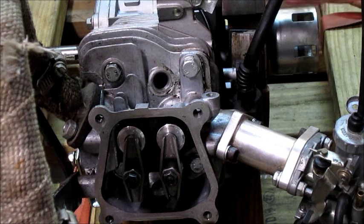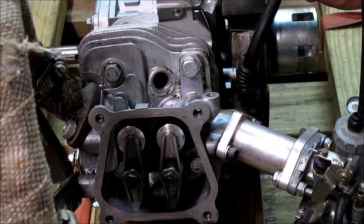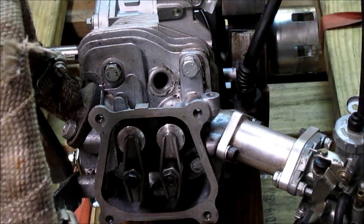Right about this point you want to take a marker and mark the top of the flywheel — the thinner the mark the better. I have a bunch of marks on here already from testing on several different engines, but we're going to put a new mark in red. When I use the timing light it's going to show up, and wherever it shows up I'm going to put a mark on the casing of the engine.